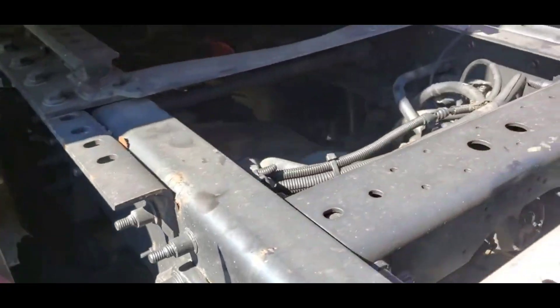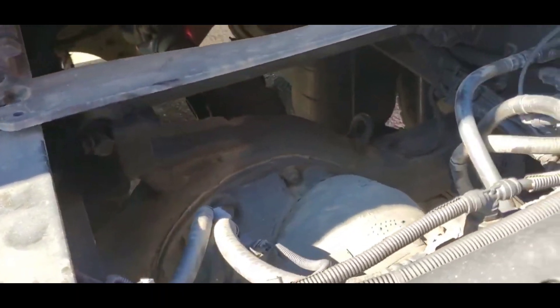So those two areas are the only places I've found that are leaking. That's how you check whenever you want to find out if you have an air leak — that's the best way to check. Make sure you release your brakes and make sure you chock your wheels. If you do not release your brakes, it's going to be harder for you to detect that you have an air leak, because you have to release your brakes so you can send the air through the system. And that's the only way you're going to realize that you indeed have an air leak, because when we're doing regular inspections, your brakes are not released — your brakes are set, right?